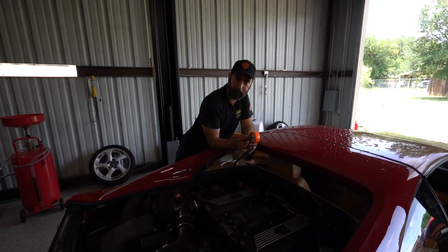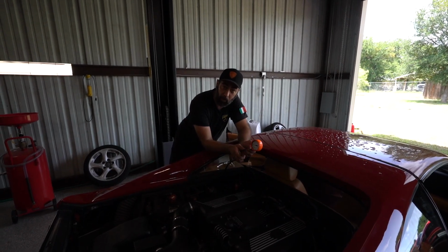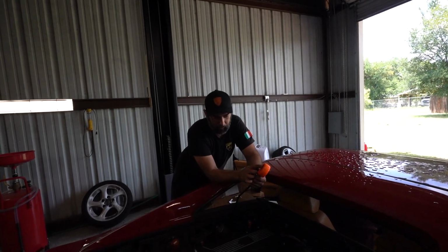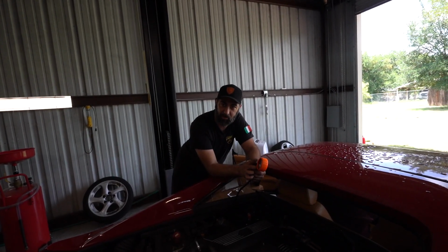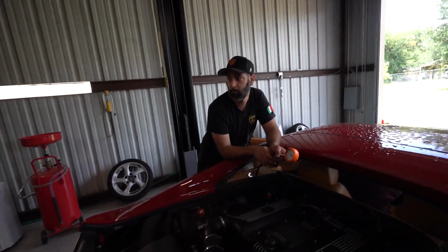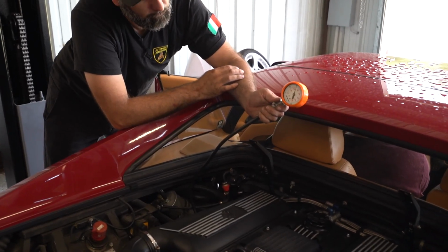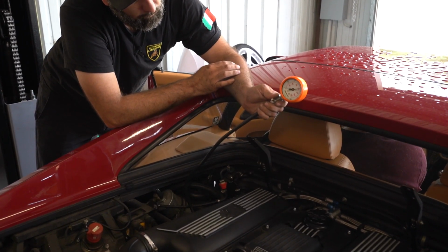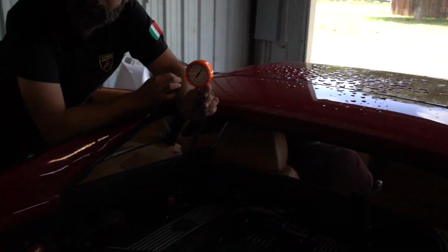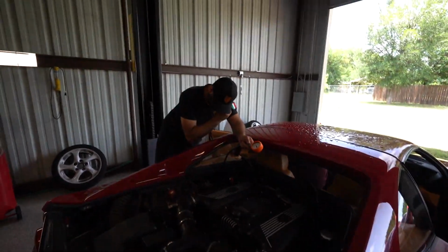You remember we were saying about 50 PSI is the first jump, which we've seen. Even on the low cylinders, we got 50 PSI on the first jump. That cylinder pulled about a 70 to 80 PSI jump on the first hit. Wow. So we already knew right there. That one also had one of the discolored plugs. Yep. All right, cylinder 7, go ahead, Adam. Whoa. Almost 200. 190? 195? Yeah, 190 is good enough. Jesus.